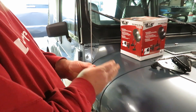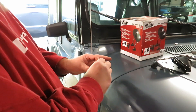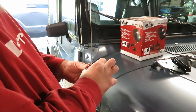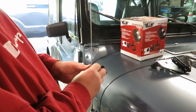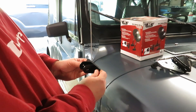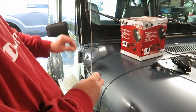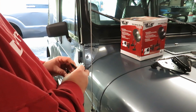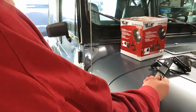I think the only way I can make this work is shave off an eighth inch here so it can get farther in and your holes line up. Then I'm also going to have to cut right here so that it can slide past that lip on my windshield. And then I'm going to have to elongate these holes closer so I can get two bolts in there. I really didn't want to do that because this is nice with a powder-coated paint. Whatever I'm going to do is going to create heat — I'm going to buckle up the paint, I'm going to have to repaint it a little bit. I'm having a hard time matching this paint. So that's what I'm going to have to do — I'm going to have to mod this out.